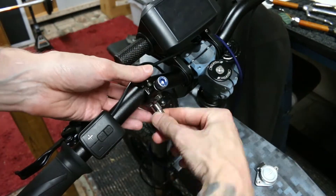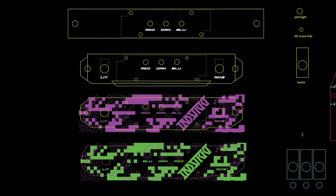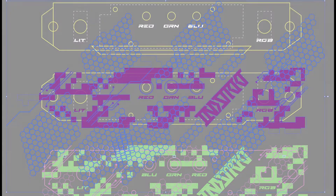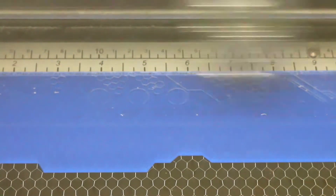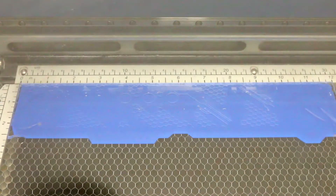Now I just need to install the mounts for the custom dash I'll be creating so we can control the lights from the dashboard. Here you can see my designs and iterations from the top to the final at the bottom. Some of the dimensions and assets I've repurposed from my previous e-bike build. Once I had the placements of the shapes, I moved on to some graphics that I'm going to be etching into the acrylic. After working with a prototype and making sure everything was correct, I moved on to the final piece — this prototype is made out of extruded acrylic. Once we know it all fits correctly and I've added any tweaks, I can then make the final piece out of cast acrylic.